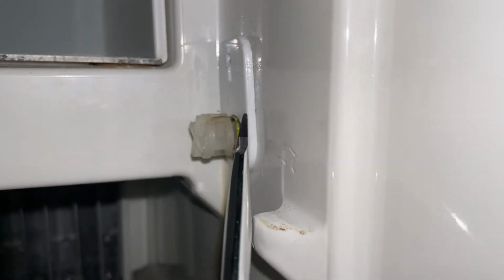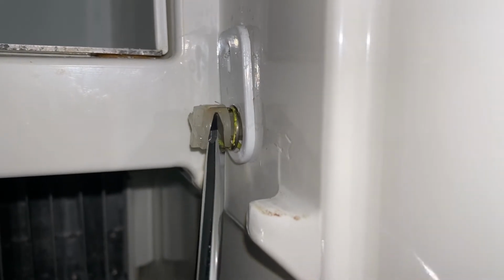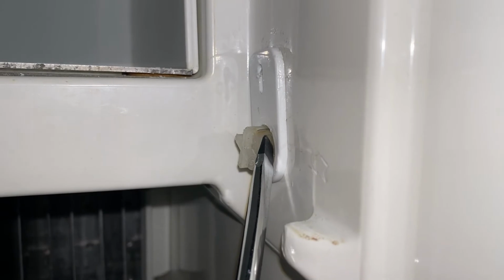When you have the air shim inflated enough, you're going to expose the head of the nylon bolt right there. Now all you have to do is use your medium-sized screwdriver to push the bolt into the wall of the fridge and disengage the bolt from the bolt receiver on the freezer door. This is a simulation of what it will look like when you use the medium-sized screwdriver to depress the bolt into the wall of the fridge.